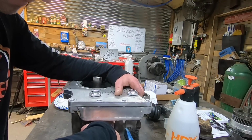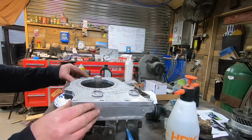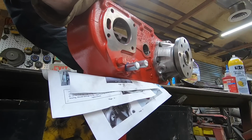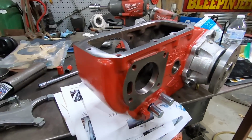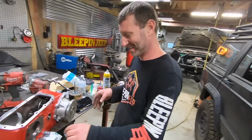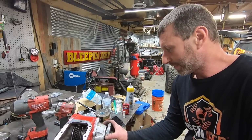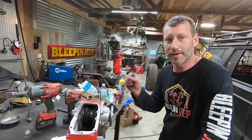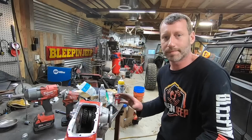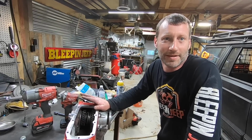The top. It's on there nice, and it will shift through the gears. So good, there's one phase, one transfer case pretty much done. You'll have the prettiest Dana 300 of anyone after this. That you'll never be able to see. We'll put a mirror under there somewhere. Yeah, we got that Novak output shaft conversion put in. It was actually really easy. It comes fully assembled, pre-shimmed and everything. You have to pull the bearing off to get one gear back on, but it couldn't have been simpler, and it has color directions if you need that, which I did.